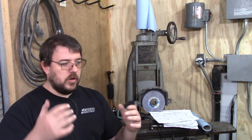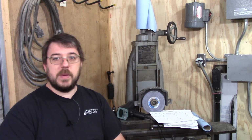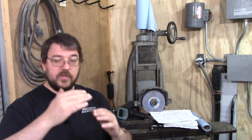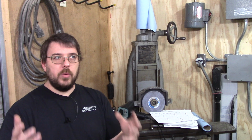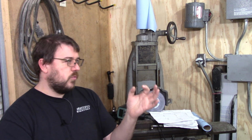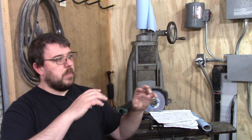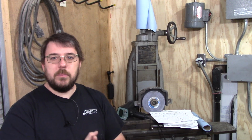Let's say you've got a hydraulic lash adjuster that's collapsing more than the others, even though it's still perfectly fine according to Toyota spec with the lighter springs. At idle, when your valve spring has even more time to collapse, that could be unbalancing the cylinder enough. Keep in mind, the motor's computer only has feedback on each bank. It can't tell individually if cylinder 1 is running richer than cylinder 3 or 5. So by having an imbalance there, your air-fuel ratio could get really bad, even though the average of it would be perfectly fine. And maybe that's what's causing our misfires.